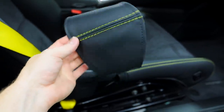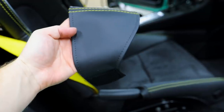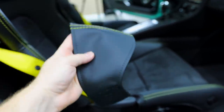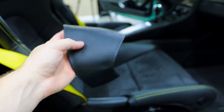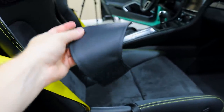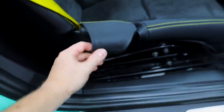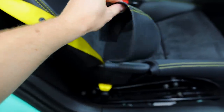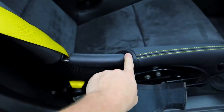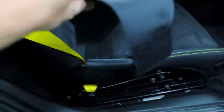Factory has no stitching, but I opted for the stitching to carry that through from the bolster up to here. People get these confused — you could technically just take this and move it to the other side, but it won't fit right. When you're looking at it, see how the right side has a slant forward in the cut and the shape? That needs to be forward towards the front of the car, and the Velcro piece needs to be on the outside towards the door — that's how you know which piece is which. So you plop this on here, wrap this Velcro piece up around into here, and the top Velcro piece just affixes itself. Line it up, make sure you get this area covered — this part of the bolster is what really gets worn down.